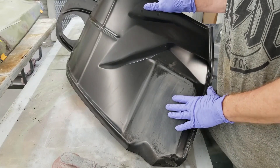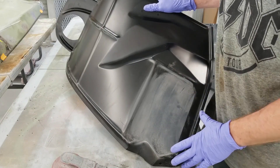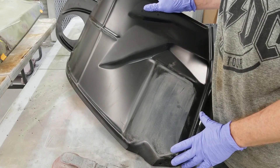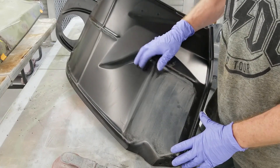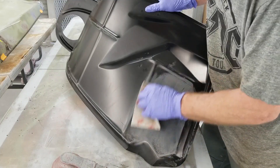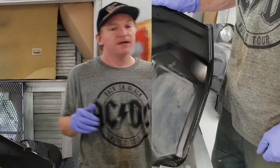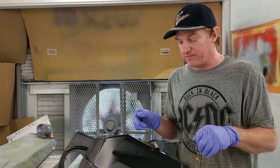It's not a bad product to paint over — depending on whether it doesn't regenerate. If it regenerates, be careful with those ones. This one we were lucky — it doesn't. But on the flip end, it doesn't want to sand easily. At the same time, that's a good thing to note because I know anything underneath this is not going to want to rust. It takes a lot more work to prep, but it's worth it.